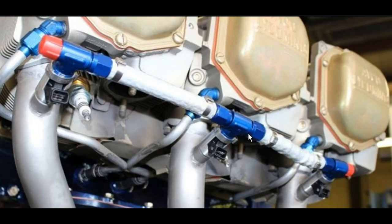Lyle's engine was originally equipped with Brand X EFI — shown here on a different engine, six-cylinder — but you'll notice they point the injectors away from the ports. The ports are up here but they're actually pointing the injectors downwards. A lot of people using this system reported throttle response and rough running issues, sometimes poor cold starting. Lyle had rough running at light throttle coming into land and some throttle response issues. We got our generation one injector mounts, which mounted in roughly the same place but angle the injector to spray up towards the port. In many cases with other customers this totally fixed the runnability issues evident in the Brand X system, and that's how it turned out for Lyle as well — he reported all his issues were gone.